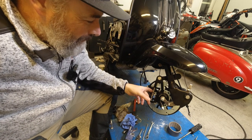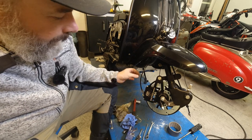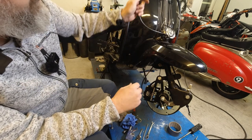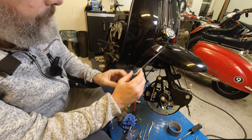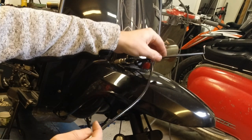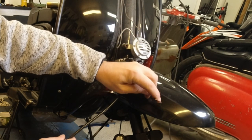I'm actually getting carried away with this - it's such a lovely piece of machine. So what I've done is I've test fit the disc, it's all loose in here, just tightened up to see that I've got the clearance right, and I'm pondering my brake route. Problem is the little hole that I've got under the headset - the head of the banjo is simply too big to go through there. That would have looked pretty neat, but there are a couple of notches in the headset so I'm going to have to put it through the headset the old traditional way. Incidentally, it's got wires for a brake light - I think they just simply plug into the horn wires there for earth and the back light. I might have to ask a grown-up about that.